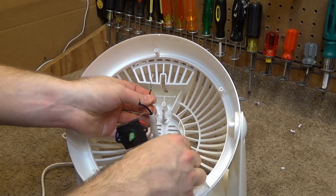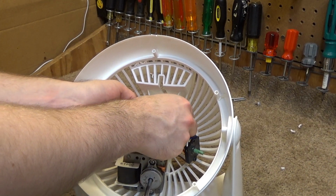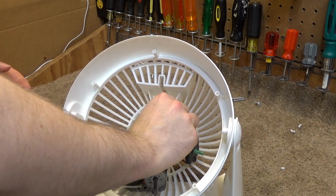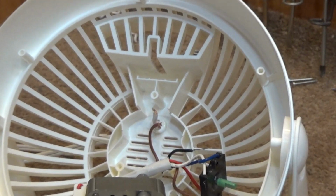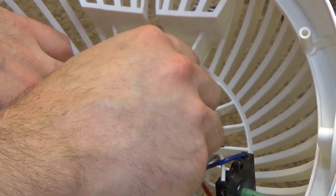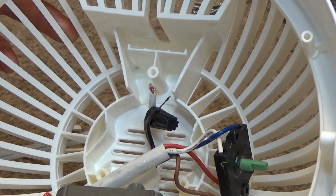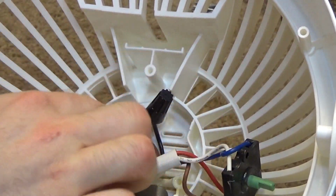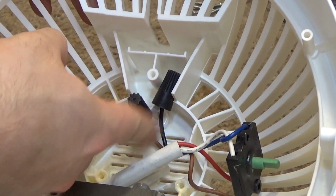So we're going to take this brown wire, and that's going to get joined with this bottom wire. You could solder these connections together if you wanted to. I think that's completely unnecessary in this case, and I'm not going to do it. It's also getting late and I'm tired, so I'm not going to take any additional steps that are not needed. Okay, now we'll connect the black wire to the common side of the mains. After that, we want to make sure these wires are not going to come out of their connections. They don't seem to want to, so that's good.